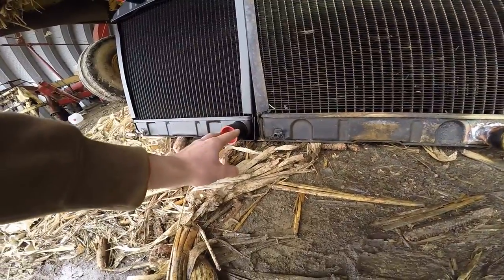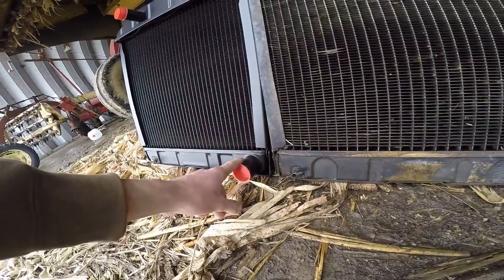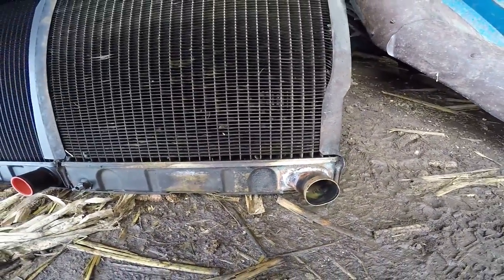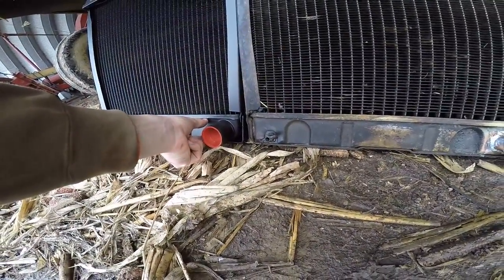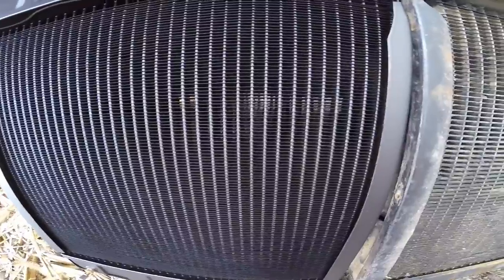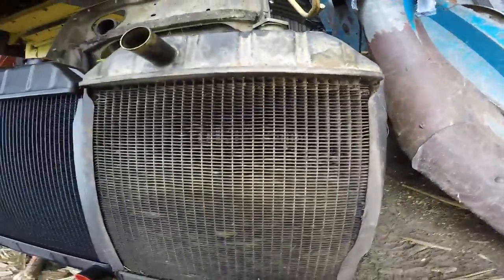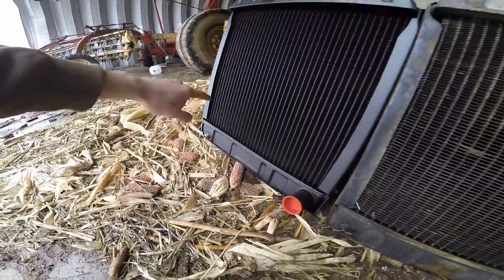The other difference is the return tube to the pump is fully round, and the old one had a big oval shape going on. I don't think the base radiator is any bigger than the old one. I think the tubes are slightly closer together with a little less space between the fins, but it's a good attempt at an aftermarket radiator. I already put the new stopcock in, so I guess we're ready to try to put it in place.